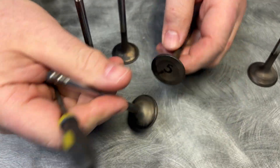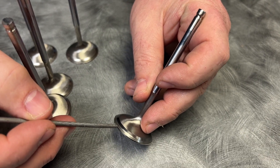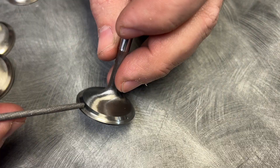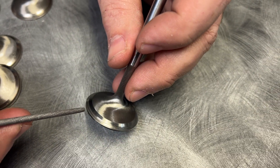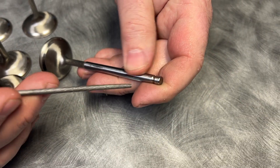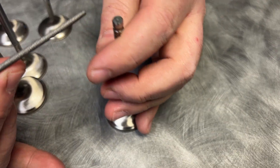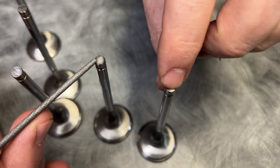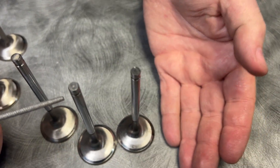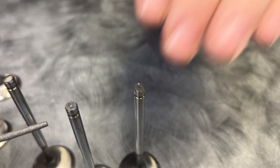These look pretty good. I think it needs a couple exhaust valves. The intake valves really show some float — they're getting beat up. Again, this thing makes 2,000 horsepower, it has 150 pounds spring on the seat and around 300 open — a lot of spring pressure, and it's definitely been popping and banging. But the valve stem looks really, really good. I cannot complain — you can tell the guides were perfect. On the tip of the valve, some of these you can see that the bucket was hitting up here — it puts like an indentation, and that's from the float. When that happens, the valve is basically going up and down and bouncing, and the bucket's also out of time and it's going to beat into the top of the valve.